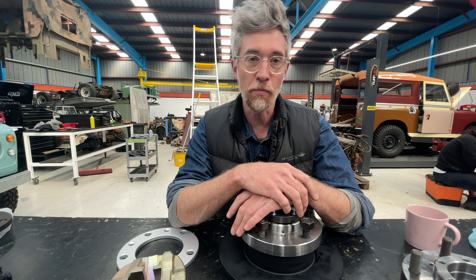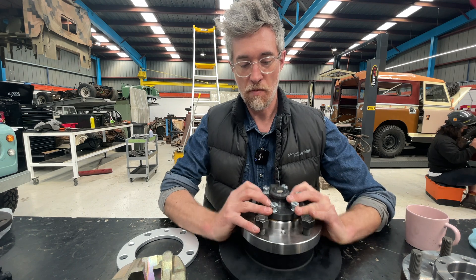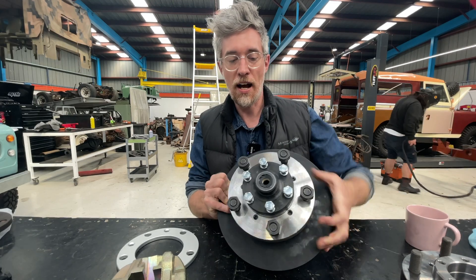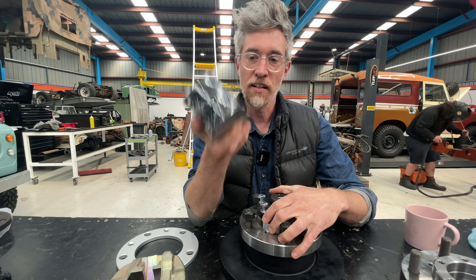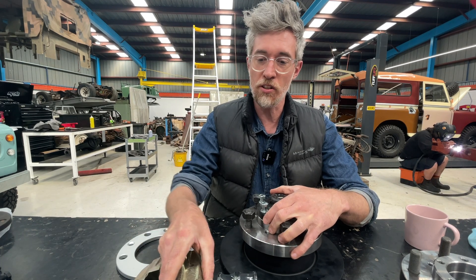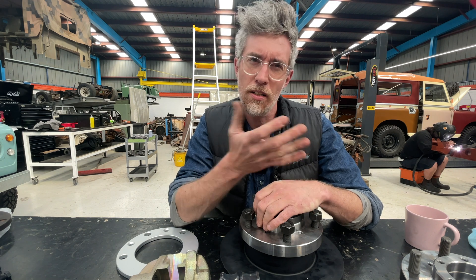Running the brake lines is up to you, but this kit includes every part that you need. The most popular option is to get everything pre-built with two sets of pads, which should last a long time since we're not trying to stop a very heavy car. The calipers and everything you need to bolt in — just connect up the brake lines and you are ready to stop.